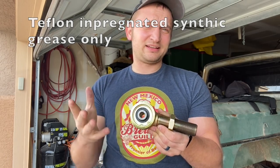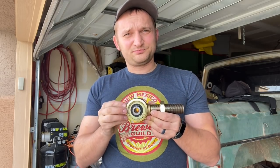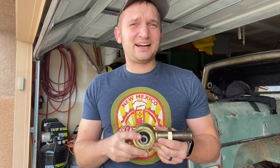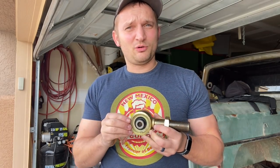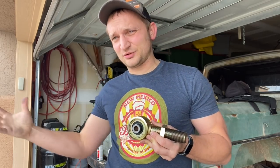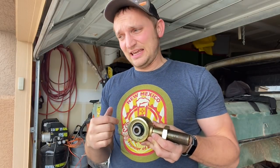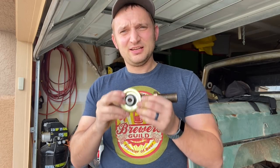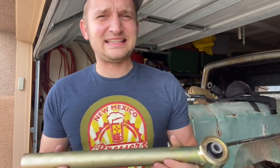There is already grease around the DuraFlex joint, and if you do replace it you will need to grease it, but it is all sealed so dirt can't get in. A big killer to any tie rod end or joint end is getting dirt inside - which is inevitable doing the type of things you do in a Jeep or any other 4x4. The idea of routine greasing is to push the dirt out, because as the dirt grinds inside it will kill your joint. This should not be an issue with these sealed joints.